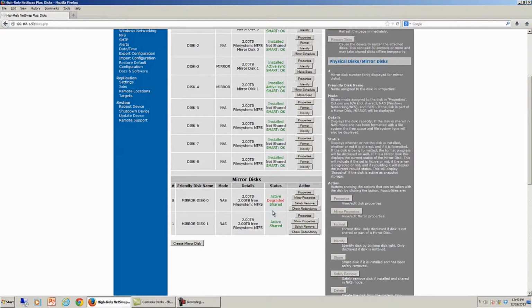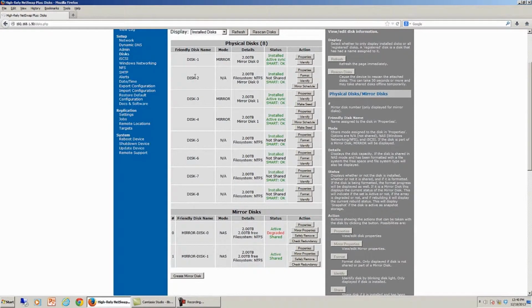So this delayed mirroring is a really cool feature. By the way, you can do this with more than just 2 disks. I could choose disk 1, 2, and 3. Okay, disk 1, 2, and 3. I could have a conventional continuous mirror between disk 1 and 2 and a delayed mirror to disk 3 so that disk 3 comes in and picks up that mirror set on Friday nights and has a point-in-time snapshot in addition to the continuous mirroring that's going on between disk 1 and 2.